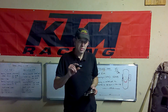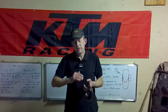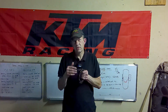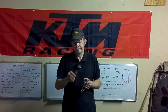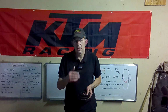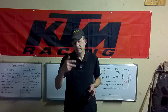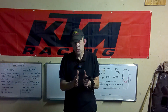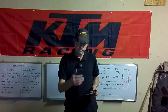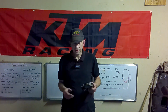I got a piece of square tubing for the stand, and I thought I'm not going to use that, because what I want to do is on the top where the stand rides on the frame. If it's square tubing, it's still hollow inside and it might dent inwards, so I'll be using a pack of steel plates. Doesn't have to be stainless. I'll just measure the height. I'll put them in the vise, squeeze them as tight as I can, weld them into a block, then I know it's solid and sturdy, cut them, and be done with the main stand as well, center stand, main stand.